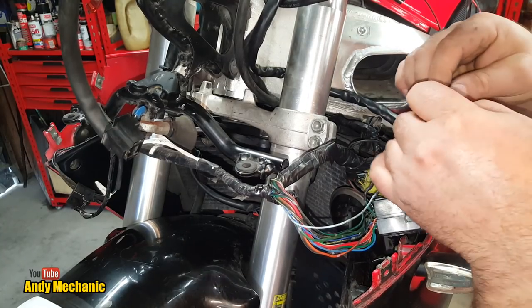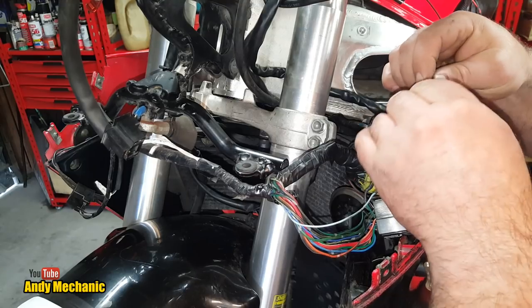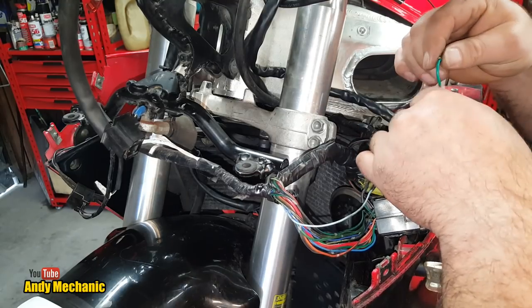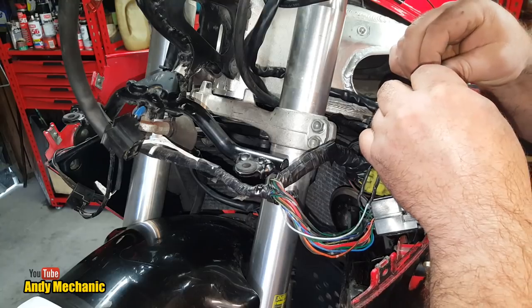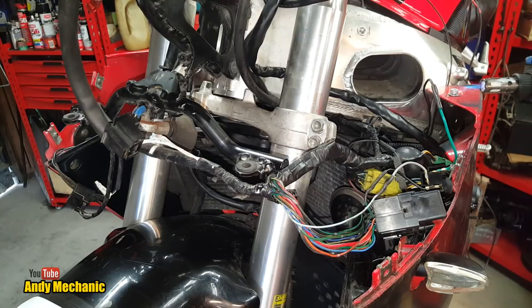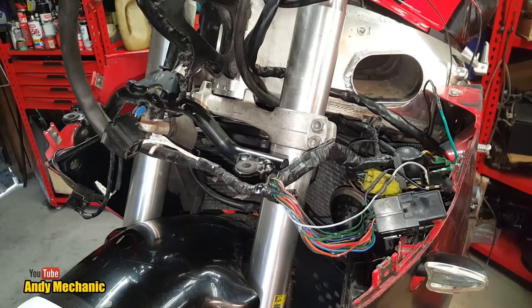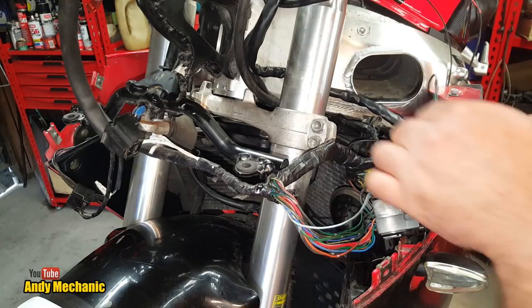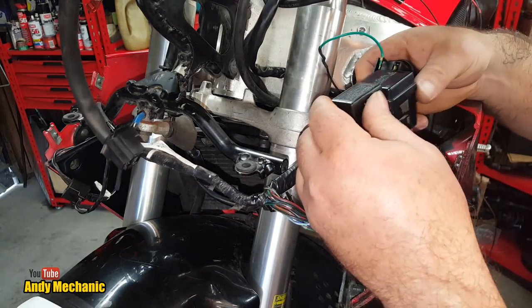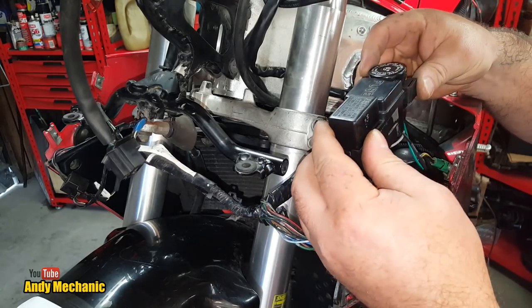You've got to make sure it's cool before you slide the heat shrink down, otherwise it can actually shrink as you're sliding it. Just never a good idea. There we go. Right, so all that's done. Now this will attach to the fairing, and I'll find a way of just zip tying this new relay close